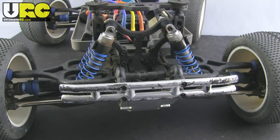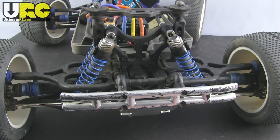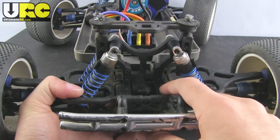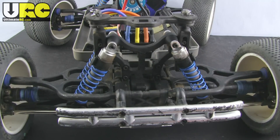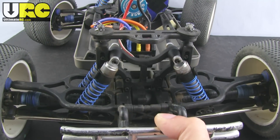Handling and speed go together really well, but they won't if your vehicle can't stay together in one piece. In stock form my Emax was breaking apart terribly, absolutely destroying itself over just basic normal driving incidents and accidents. To improve durability — which was really key for this vehicle — I went with RPM bulkheads. These are nylon, a much stronger and slightly more flexible plastic with a very different design. They have a lot more beef, are direct bolt-in replacements, and will give you much better durability.